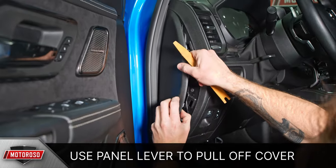With everything installed and connected, replace your fuse in the fuse holder and the steps should immediately retract and calibrate. Now go around the vehicle and test each door to make sure the steps and lights are functioning properly, and you've finished installing your Amp Research PowerSteps.